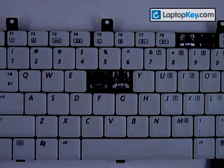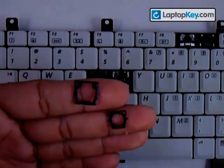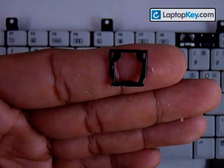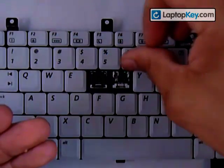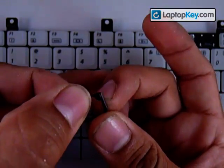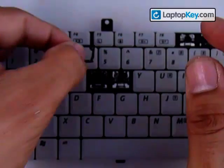The position of that single hook is going to determine the position of these pieces. What we're going to do now is click these two pieces together into one piece. Start out with the larger piece — you can see that at the bottom corners it has two sticks hanging out, and at the top corners it has two holes. Those two holes are going to go wherever the two hooks are; in this case they're up, so we're going to put the two holes up. Make sure not to put the whole piece upside down — feel underneath the bottom sidebars, the vertical ones. If you feel a bump there with your nail, that bump has to face the keyboard, and on top it's just smooth. Now you know the position for this piece — put it down in the right position.